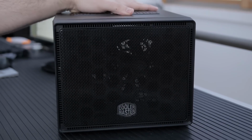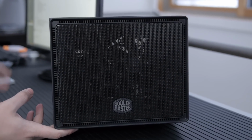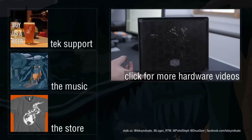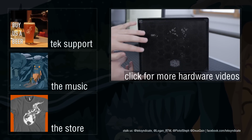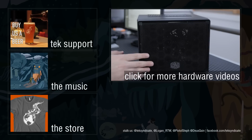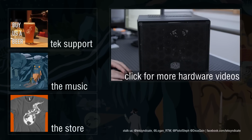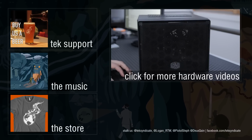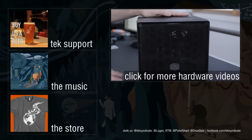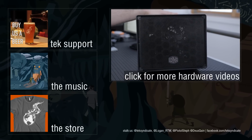So to sum it up, what you have here is a nice case that makes a few sacrifices to be this small. I do want to also note that the entire front here behind this, there is mesh, because this is going to be your main intake, so that's going to really help as far as dust goes. So I think the best way to run this would be to put a radiator in the front and then overclock your CPU a little bit. Otherwise, you're going to be suffering with a very small CPU cooler. If you're not overclocking, you can get by with that just fine. But all in all, it's a pretty empty case, and there's a lot you can do with it. So there you have it, Cooler Master Elite 110.